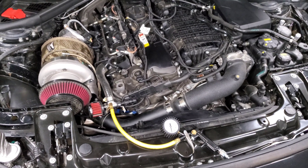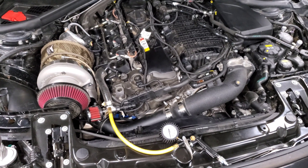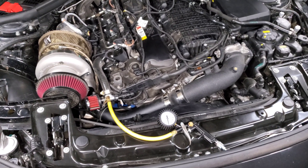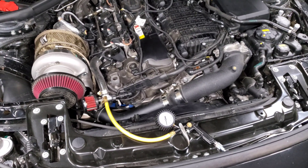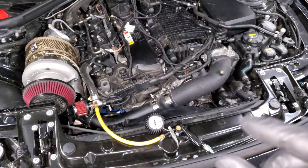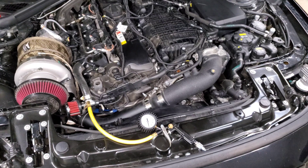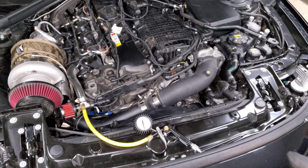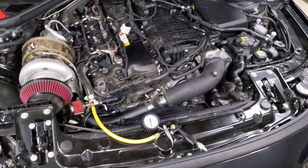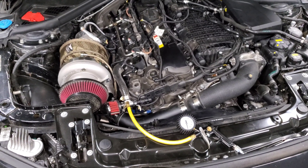Another reason why this is important is because when you upgrade your fuel pump, sometimes you'll need to change the settings in the tune. When upgrading to a Dorch or a Spool high pressure fuel pump, you'll need to check the box in your tune to make sure it's calibrated appropriately for that pump. What's actually being modified is the setting for that sensor on the pump itself.